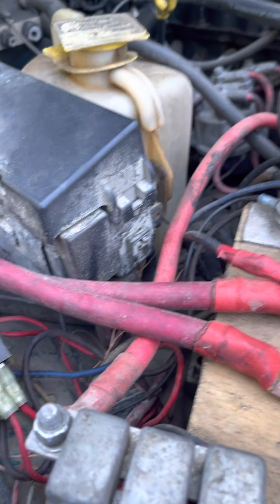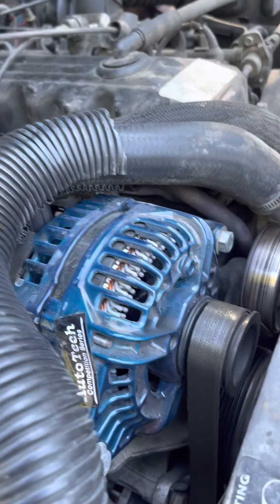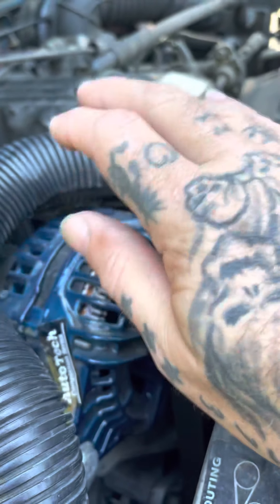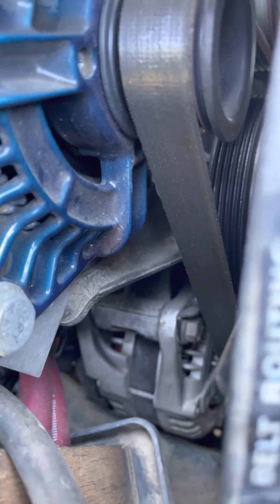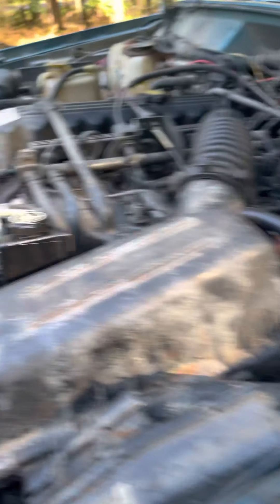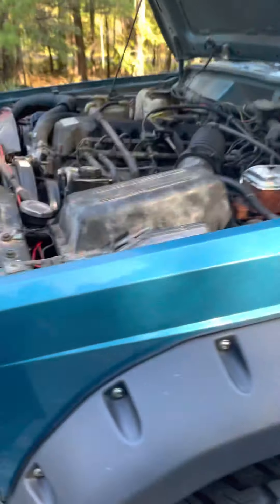I don't fuse any of my amps or anything. This is the Autotech Engineering alternator - I believe they said it was like a 370, they put out right at 400 on the paperwork they gave me when they tested it. There's also a Brand X 320, so two alternators. Everything else under the hood is pretty much stock except for the motor, which is out of a 2000.